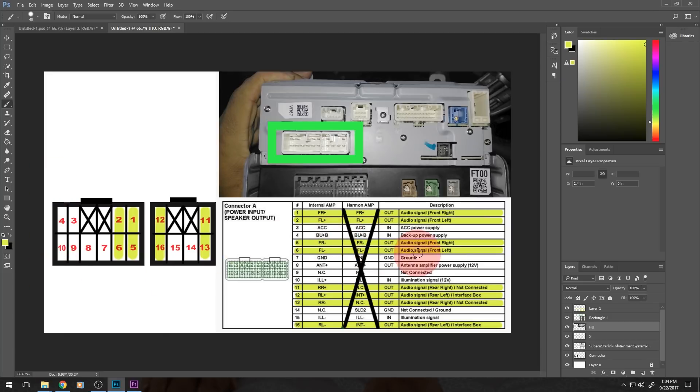Also, although I don't show it here, you'll also need three cables: your accessory — number three, that's going to be your blue cable, the accessory power supply; your number four, it's going to be your 12 volt supply to your amplifier; and number seven is going to be your ground. That's if you're connecting it straight to this. I didn't do this — I connected it straight to the other amplifier I already had — but if you don't have another amplifier, then you would connect it to number three, number four, and number seven.